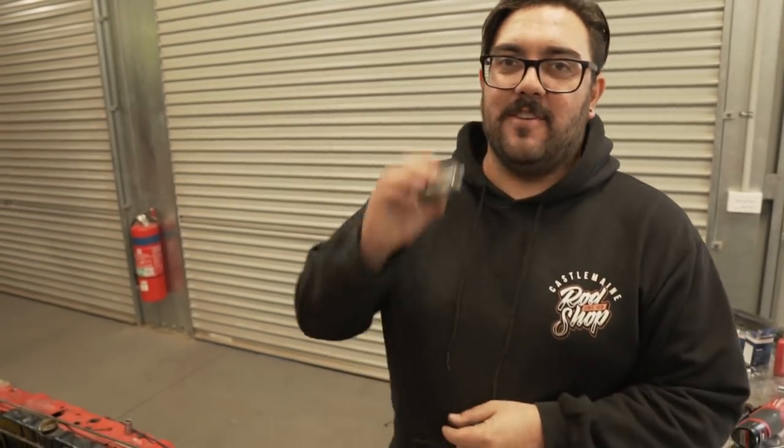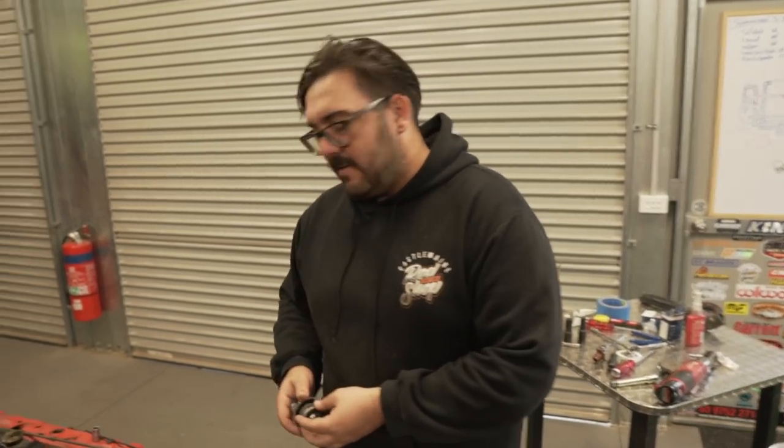All right, so all we've got left to do is the radiator cap and throw the air filter on. That's about it mechanically. Oh, and bleed the cooling system, which is a good time for us to heat it up. Heat the oil up, throw it on the hoist, drain the oil, and then I think we'll be good. We're not trying to make it turbo ready. It's been sitting for a long time, so we're just replacing the things that are cheap and the things you would replace.